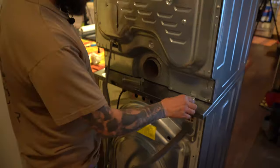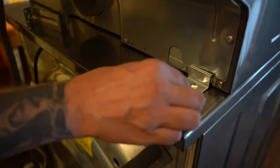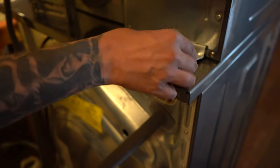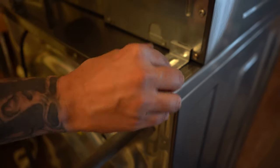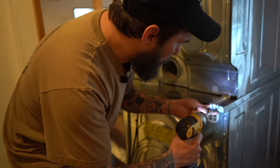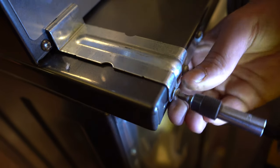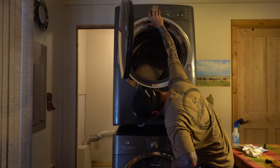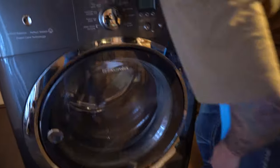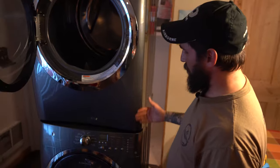We've got to put these brackets on here. I measured it out, double checked it — for this particular setup it takes a long set of brackets with a little notch right there. All you do is stick it into that slot, slide it all the way over to the right, take your square drive. Just lift it up like this, find your blue tape, peel it, and stick it on there. Just be careful when you go to move it around that you don't put a whole bunch of pressure on the top, because all that is holding it down is adhesive.